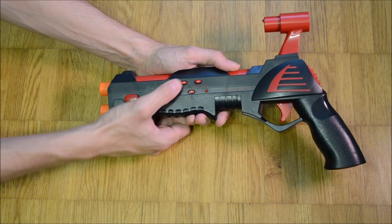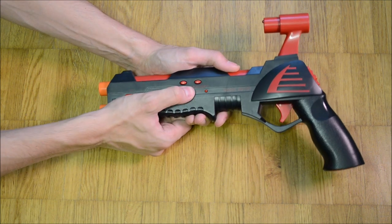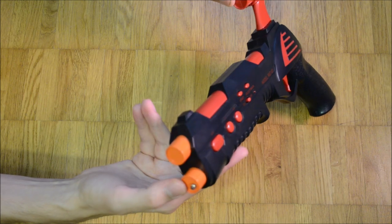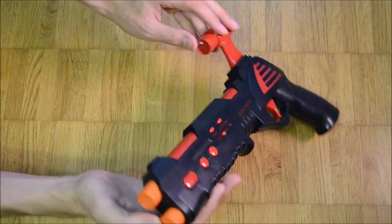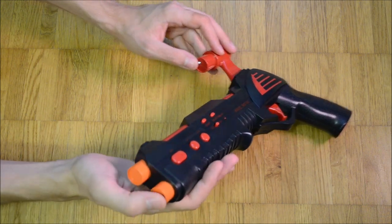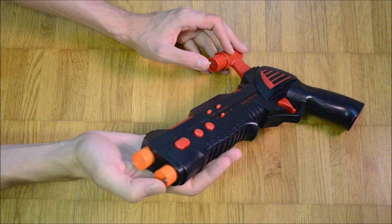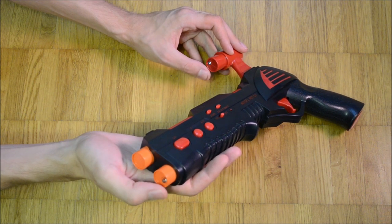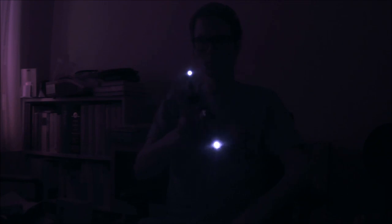Similarly to the Wii, a light sensor pays attention to the relative distance and angle of two infrared reference lights. One of these IR LEDs is located at the lower barrel at the front of the gun and the other one is at the detachable antenna-like attachment at the top. This is footage of an infrared camera filming the gun to give an idea of how the tracking works.